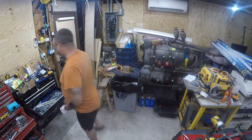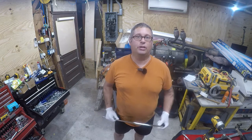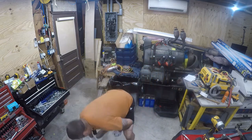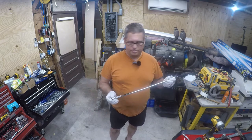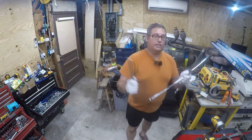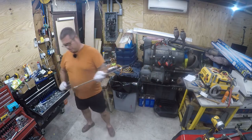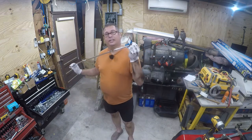And that's not all, because it's 36 inches from the back of the transfer case to these bolts. So you also need some really long extension rods. But this is the secret weapon — a 24, an 18, and a 12 that come in a set for $19.99 on Amazon. I'll put the link in the video description. This is how we're going to get to the bolts on the back of the transmission.